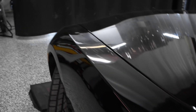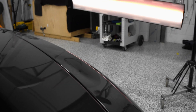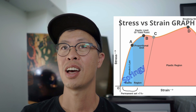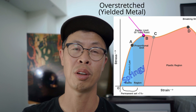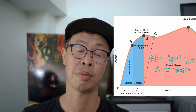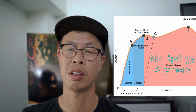For sure, I thought this was going to be oil canned. It's a pretty flat part of a fender and I didn't even know how bad the access was going to be until I took things apart. The thing with dents like this is that they look very overstretched. In metallurgy and mechanical engineering, or material properties, there's a point when you stretch steel or aluminum or most metals that it's gone to a point where it's not going to spring back anymore. And steel is a little bit more forgiving than hardened steel, high strength steel, or aluminum. In this case, it looked definitely beyond the point where it would spring back.